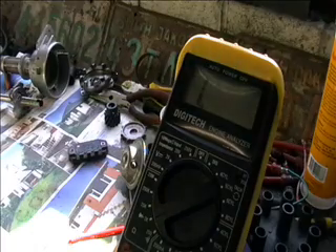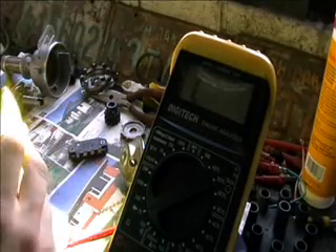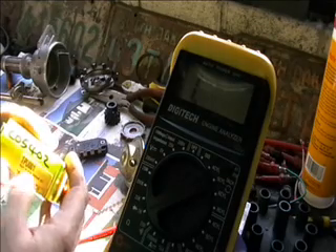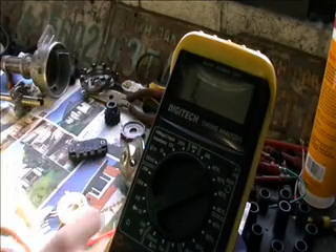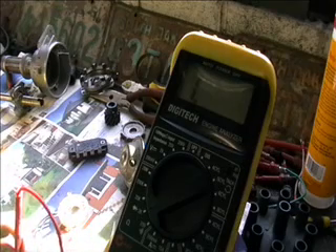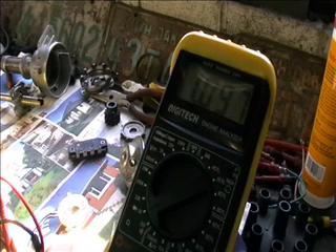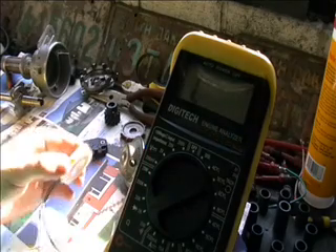But, as in the cooking shows, here's one I sorted out earlier. The replacement — this is not a Bosch unit, this is a Triton TPU-001 pickup coil repair kit. Nice new unit. And on this, if I go and test the resistance of the pickup coil, actually put it on the terminals, I've got about 1000 ohms, which is exactly what you should see.